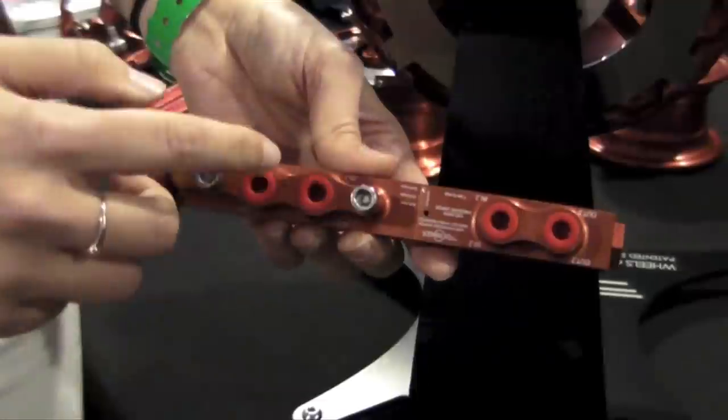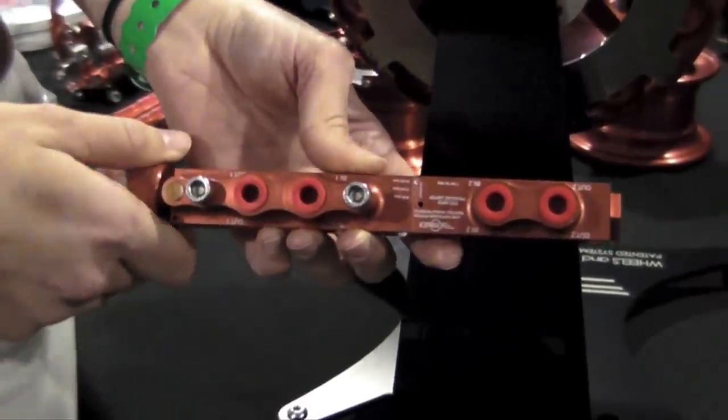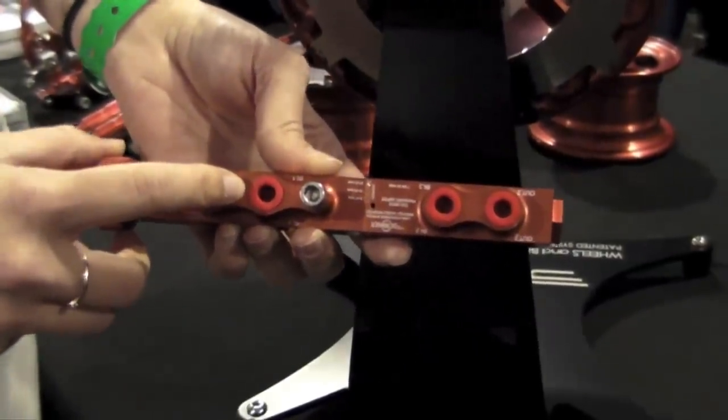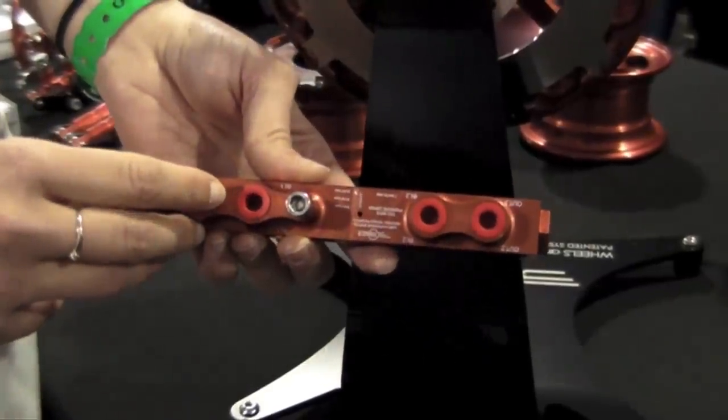As we provide complete kits for LSA, this little device — a passive hydraulic anti-lock kit — comes with all the kits. It helps regulate the pressure between the left and right side and avoids locking the wheels on the aircraft, so it really adds a lot of safety on the aircraft and during landings.